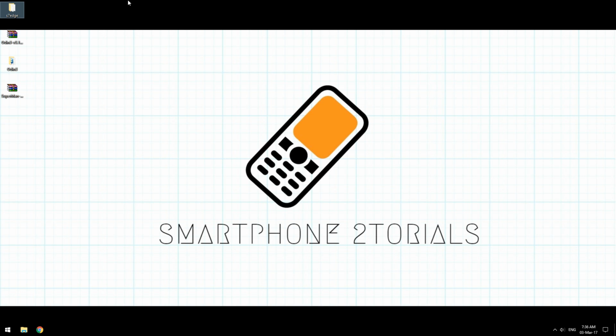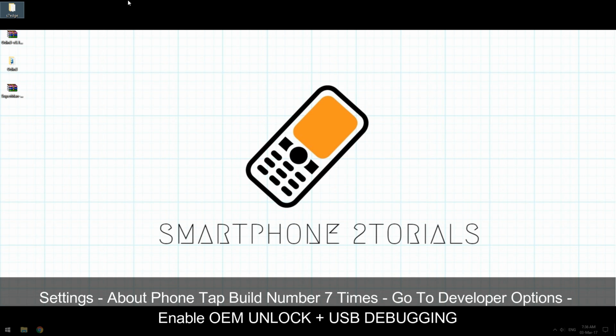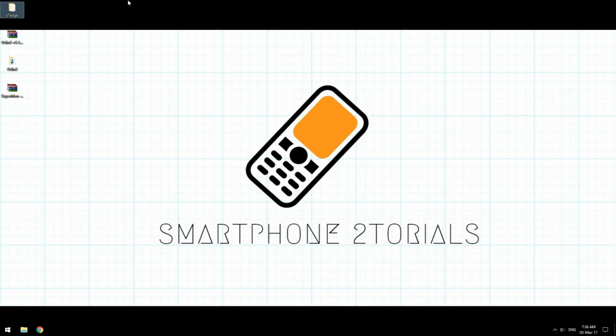Alright, so a few things to take care of. Ensure that you're signed out of your Google account, your Samsung account, all accounts on your phone. You've backed up all your data. 50% battery is there on the phone. You need to go to settings, go to developer options, and enable OEM unlock and USB debugging.